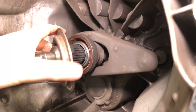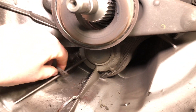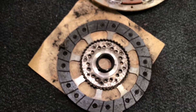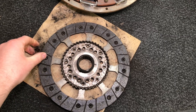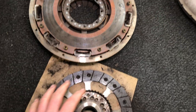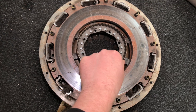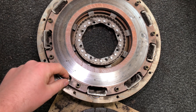That hadn't helped matters at all, and there was also lots of clutch debris in the bottom of the bell housing of the gearbox. Going over to the old clutch — we've got the twin plate clutch. One plate here is quite low down to its rivets and material, but not actually missing from this one; it's from the captive one. The other clutch drive plate has material which has all been thrown out from the inside.